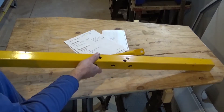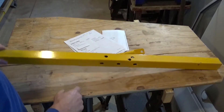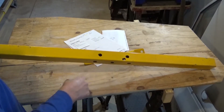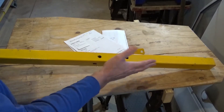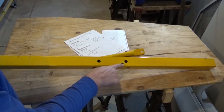This is the main support that holds the braces that bolts onto the car. What I found was some of the holes aren't true — the bolts won't line up with the other components. So plan on reaming these a little bit with a half-inch drill bit. You might get a good one, that's fine. That's why I marked these.